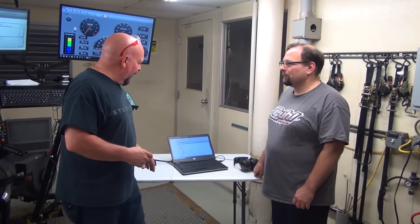You had told me about a gentleman that I know had an H2 that wasn't running well. What was wrong with his? We read the code out and sort of reverse engineered it. As soon as we fired it up and ran it, I knew something was desperately wrong. We took one of our ECUs and plugged it in, and it ran just fine. So we knew that the problem was in the ECU. It was easy to fix. We just reflashed it with the right stuff.